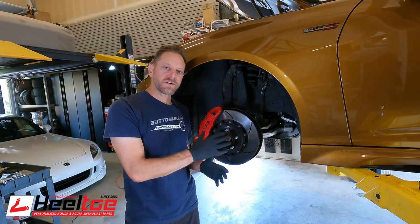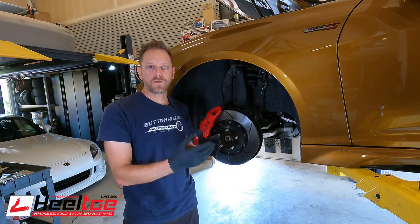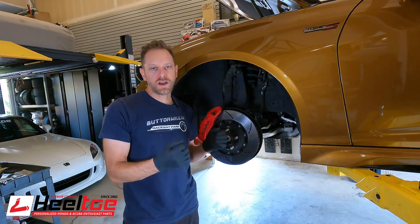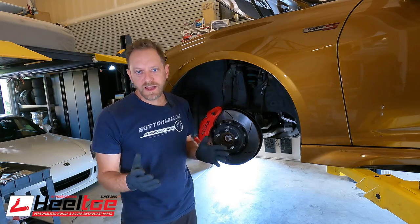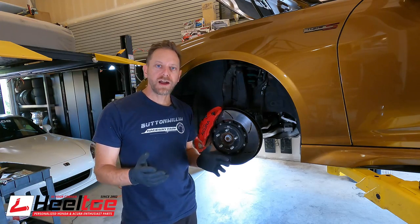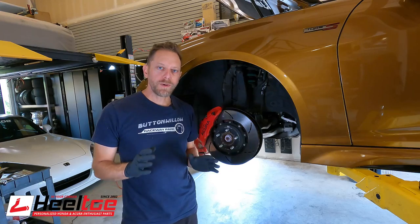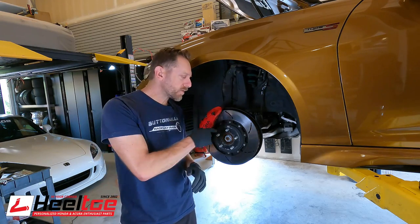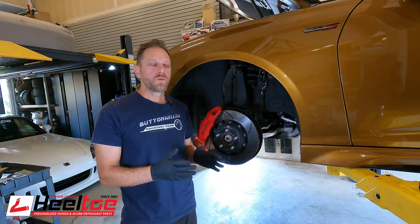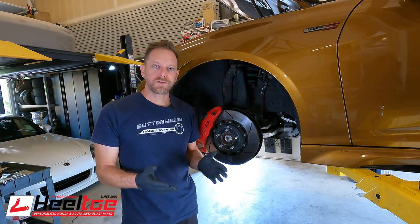This transfer layer is actually not smooth. It's got high and low spots, high and low friction spots, and this is what causes shaking when you try to brake with your car. That's right — it's not warping that's causing that. I did a whole podcast about this that I'll link in the description, but if you want to know more about the brake rotor warping myth, definitely listen to that. These rotors are shaking a little bit when we come to a stop, even in moderate driving, which is super annoying.